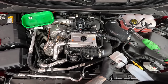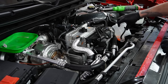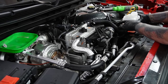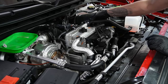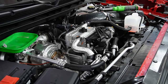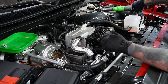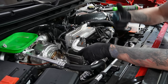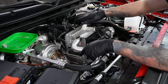Let's go ahead and get one more shot. We're going to have to accept that right there, which is fine. Put the dipstick back in so that way we don't have any issues. Now, this is our charge air cooler right here — that's what we need to get off. These hoses come off because we have replacements with the charge air cooler kit. When you pull off the sensor, move that out of the way.